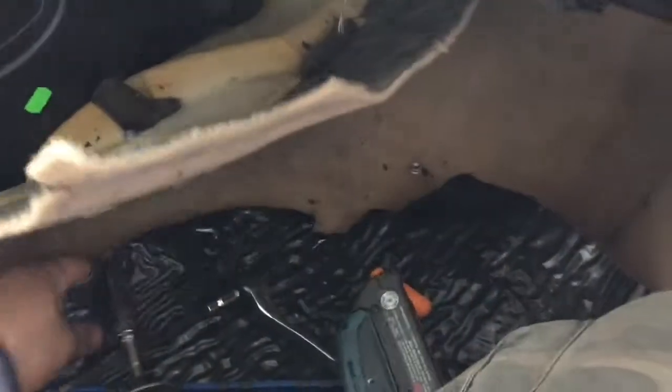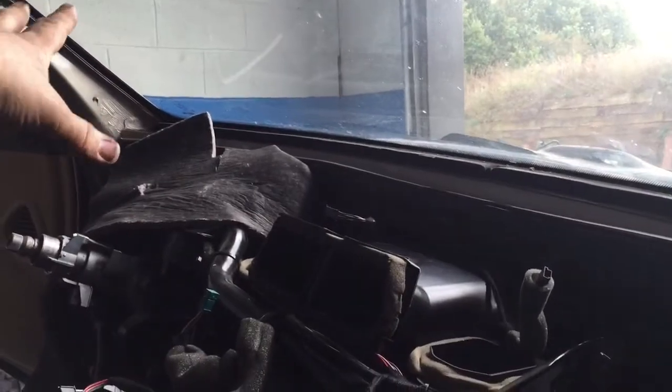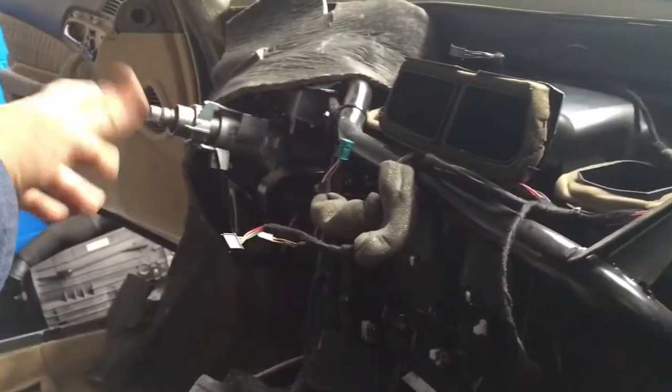There is a cover on top of the dashboard — you take that cover off and you're going to see a bolt holding it there, one on the other side. And of course before you get to that point, you have to take the steering wheel out, the whole command unit and everything out, and disconnect all the wire harnesses that connect to the glove compartment and a million other things. It's not a simple job.